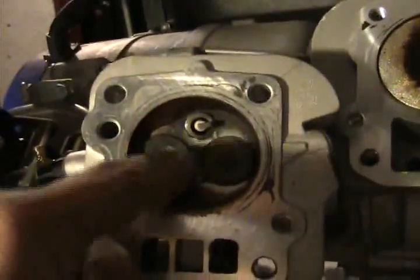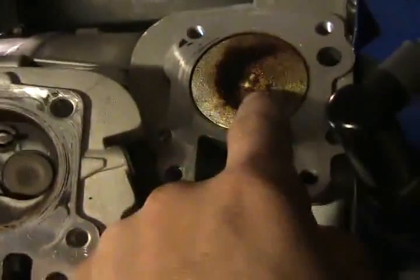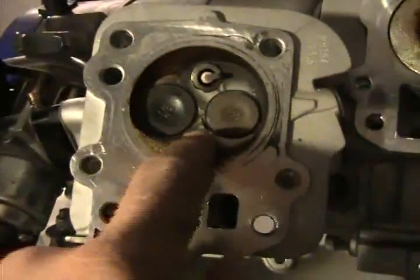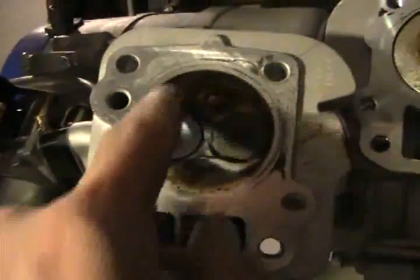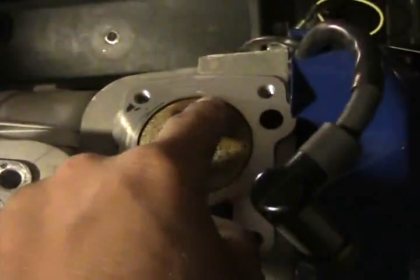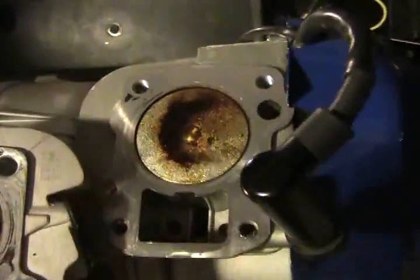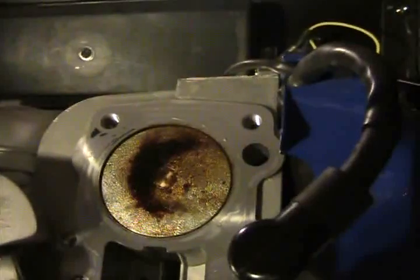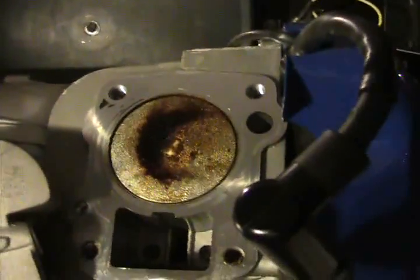This edge and this shape help form this right here. You'll notice that the bottom of it is smaller due to this protrusion into the combustion chamber, whereas this open space gives us this much larger area of enriched burn, which is the cause of the deposits themselves.